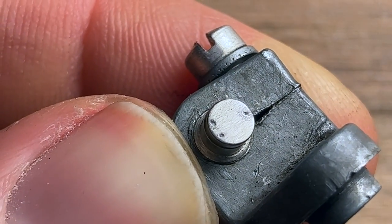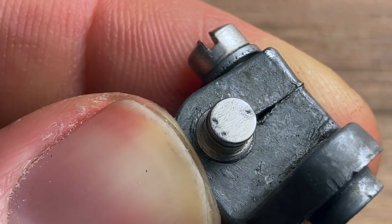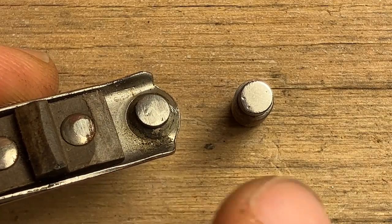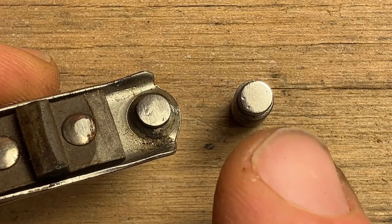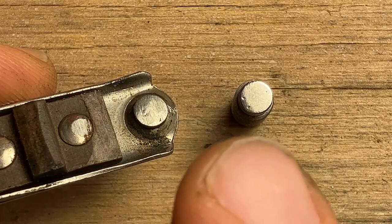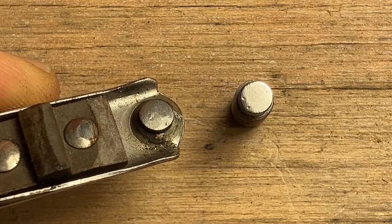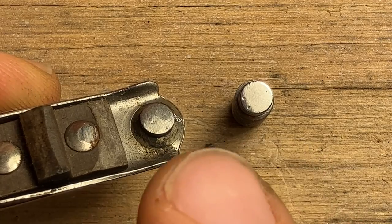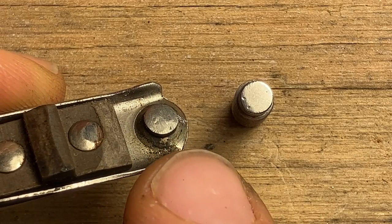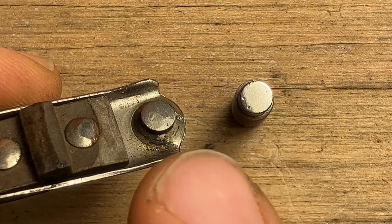After a few passes, you can really see there are three pits here, so we've got to continue filing until these pits are gone. I've got these pretty well cleaned up now. The point block took a while — you can still see the tiny remnants of those pits. There were three of them. One thing interesting from an electrical engineering point of view is that the point block had pits on it, and when I got in there I could see that the point arm had a bump on it. Sometimes this is called a spike and crater that you get from an electrical arc.